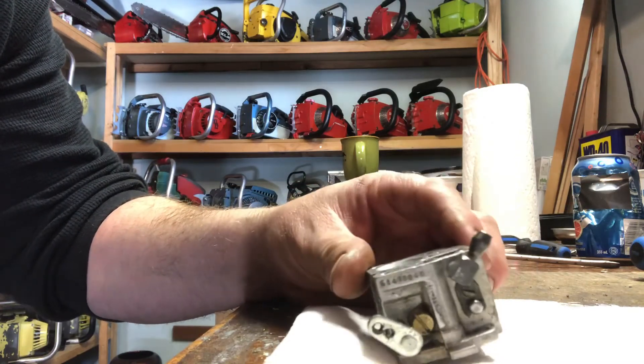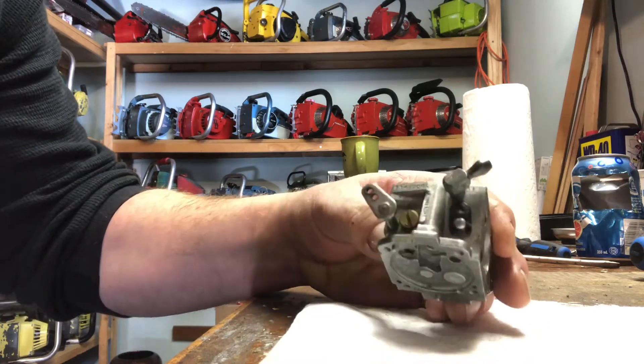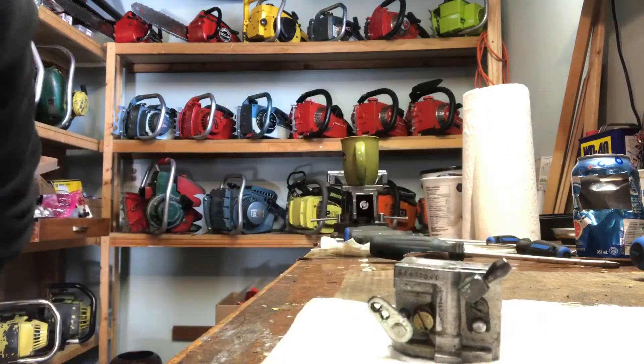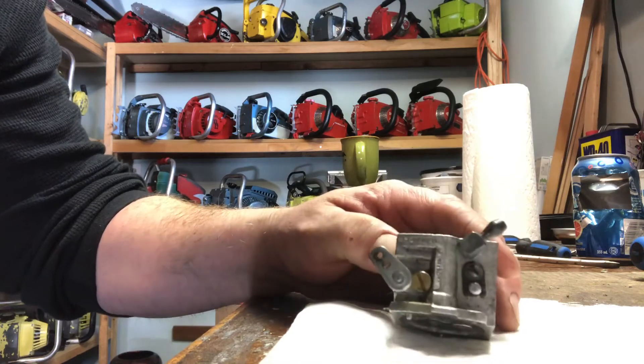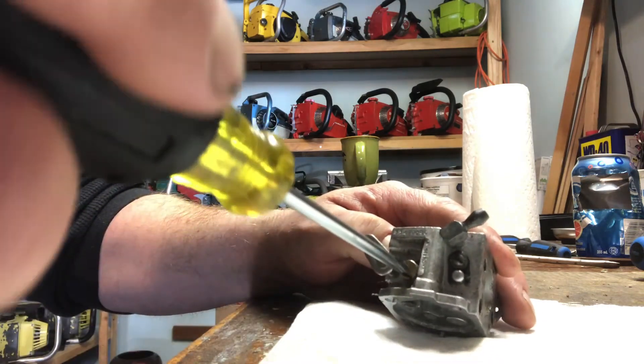I'm a little leery of that, to be honest. I just measured the bore on the P50, and apparently it is a 52mm bore piston, so it definitely has a P50. Maybe there's something different with the nozzle that's in here — there's obviously something different — but one thing I don't like is the governor that's on these things.